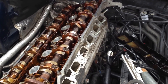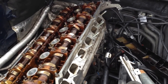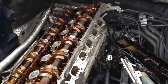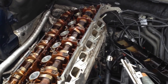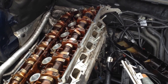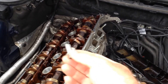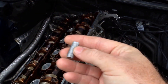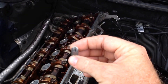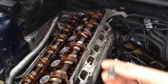I was doing the very last bolt, only on the second torque spec, not the final — felt a little bit squishy, not bad. I thought, well, I'll go ahead and pull it out and check it just in case there's a little bit of oil left in it, even though I cleaned the holes out. Slid the bolt back out, and this is what's on the end of the bolt — that, my friends, is the threads from the inside of the block. It's aluminum threads. Pulled it out, totally stripped it.